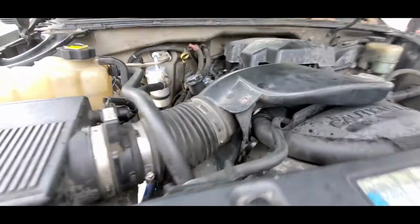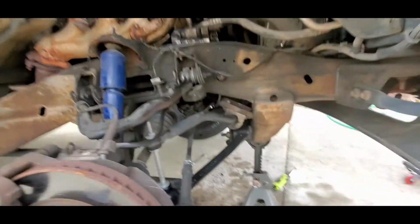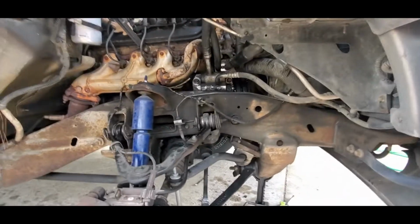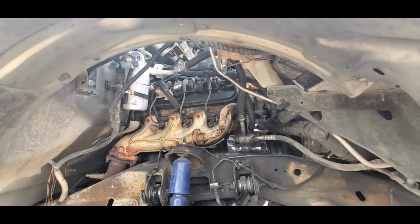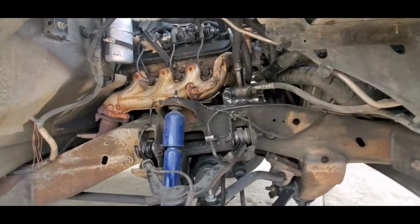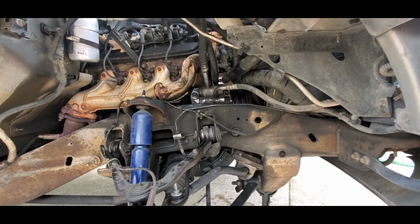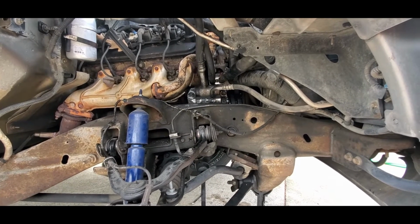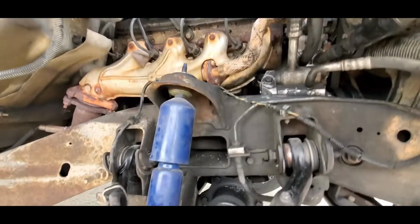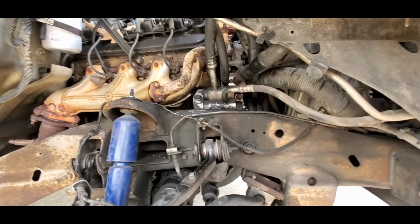The main thing I wanted to tell everyone is this was my first time replacing the compressor on this truck. The biggest thing for me, I did see a video where the guy did say take off the wheel well plastic, and I just went ahead and took off the wheel itself. Gave me more room to work. Getting underneath when it comes to putting that belt on, it's a lot easier if you go ahead and take off that tensioner pulley down there at the bottom. And it also let me discover another trick that I can get to my spark plugs a whole lot easier as well. But that's pretty much it.